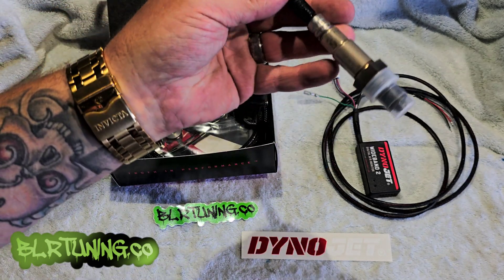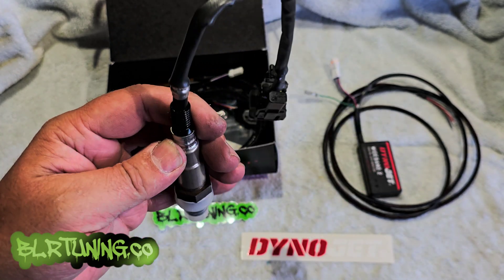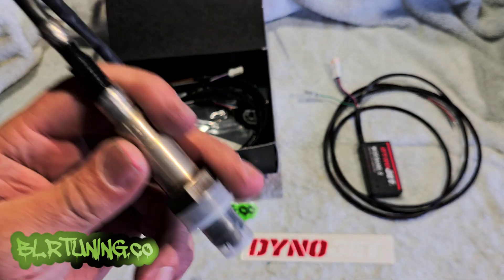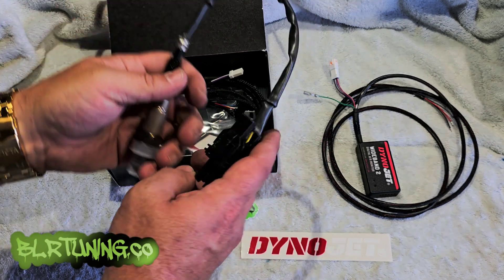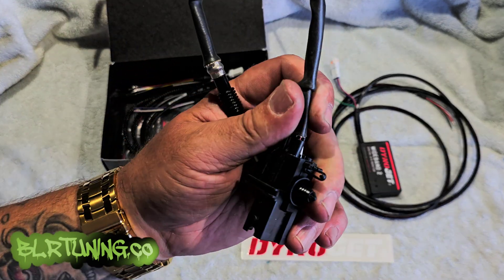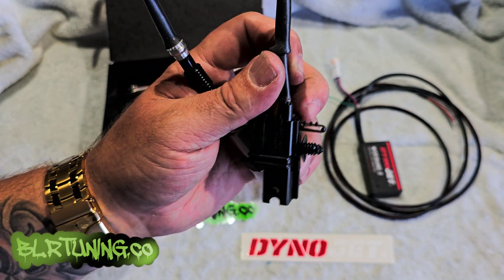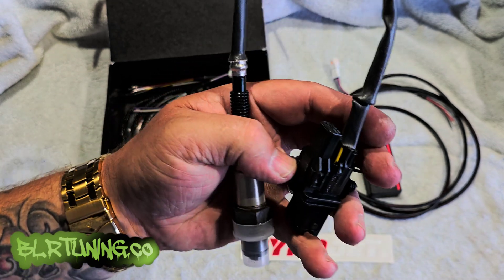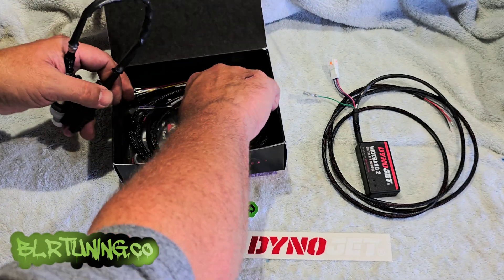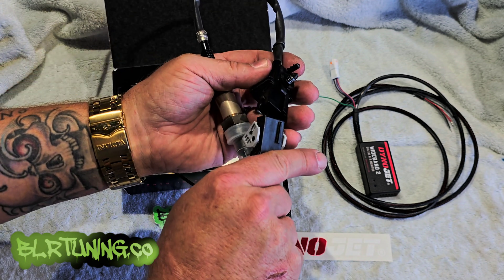You have your six-wire Bosch O2 sensor. Remember, O2 sensors are delicate — don't drop them, don't bang them around. If you banged it against something by accident, you probably did damage it, and then you power up the bike and something ain't working — probably because you destroyed the O2 sensor. It does have a big plug with all kinds of different mounting options. You can throw a zip tie through that hole, feed it through a plug, or cut these off if you don't need them.